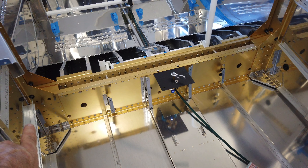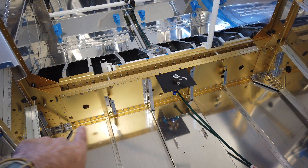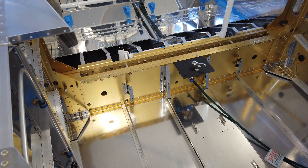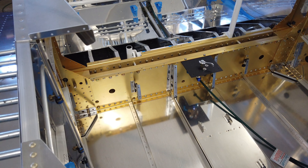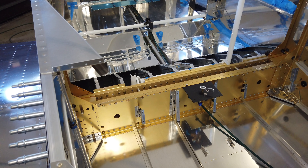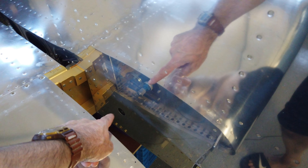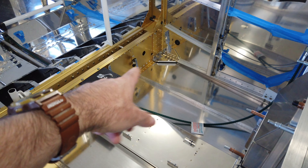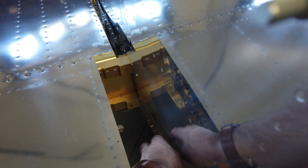Yesterday I fooled around with this side — I was going to fabricate and connect the line for the right tank, and I planned on using this supplied super-soft 3/8 aluminum tubing. But I managed to mangle that line pretty good, and I figured it probably wasn't worth the effort to fool around with it now. I think it will actually be easier to do with the wings off, so I can run the line through and get my bends in it.